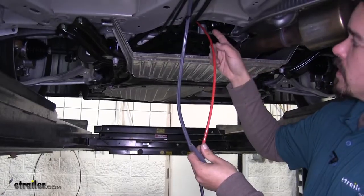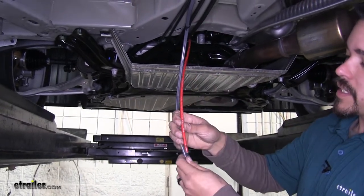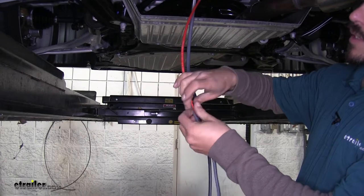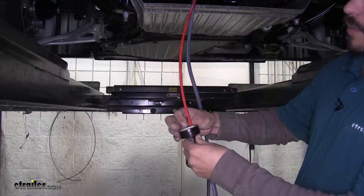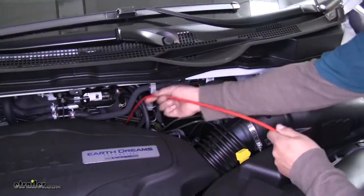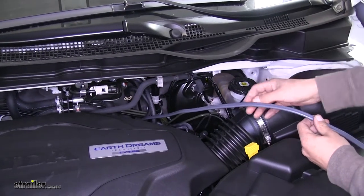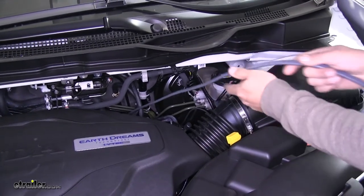Here's where my airline tube came out right by the belly pan and these existing lines. Take my airline tube and wire, and use a little bit of electrical tape to tape it to the airline tube so I won't lose it when I start pulling it up. Move back up top and start pulling everything up to the engine bay. Once you get it up here, make sure you pull all the slack out because you don't want a big wad of it hanging down underneath and potentially catching on things when driving.